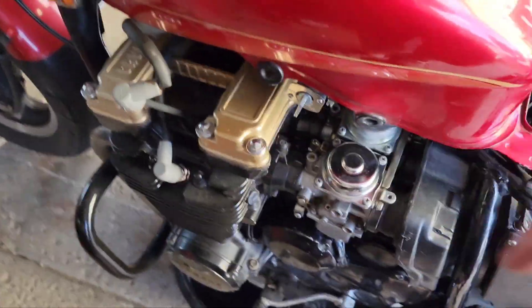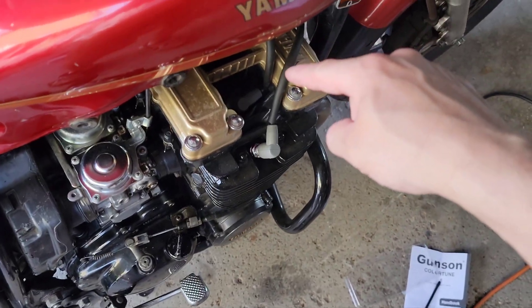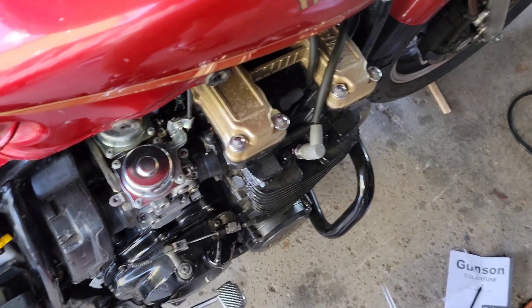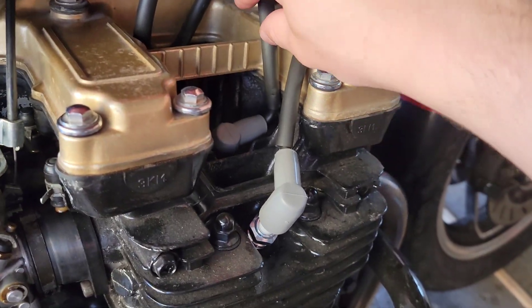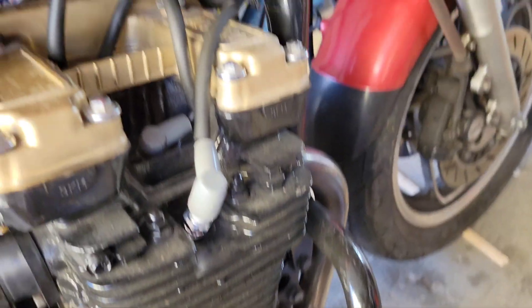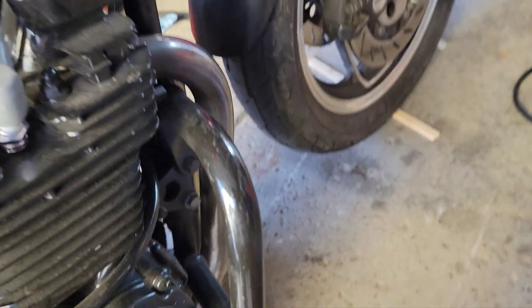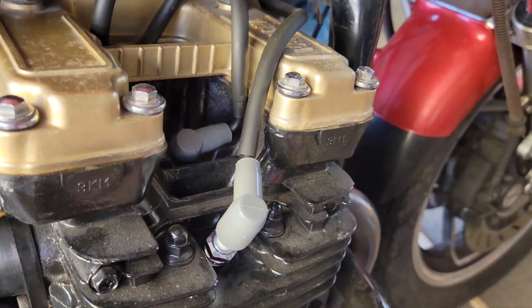I said I was going to go to number three, but I got so excited that my bike is finally coming back to life. I went through one, two, three, and four with the ColorTune — it worked great. A little tip for getting in there: needle-nose pliers are going to be your saving grace to avoid burning yourself. Grab the plug wire, pull it off, then use your ratchet to get in there. Then you don't burn yourself.